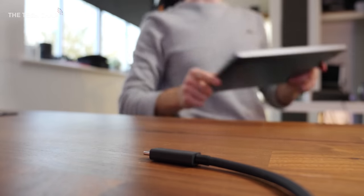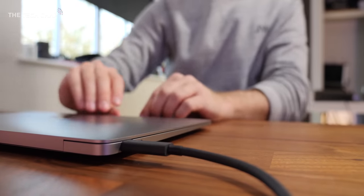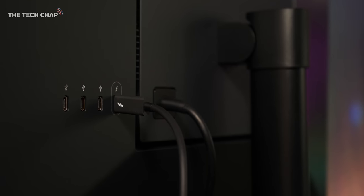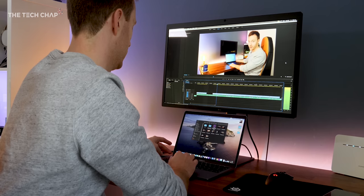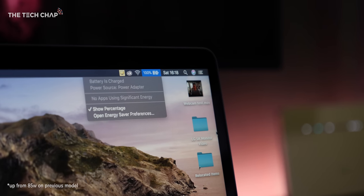I think it's great. All you need is one cable — one Thunderbolt 3 cable that comes bundled in the box. Plug in your MacBook Air, MacBook Pro, Dell XPS 15, whatever Thunderbolt 3 laptop or PC you have, then connect it to the Thunderbolt port on the back — the one with the ring around it — and you're done. This one cable takes care of video, sound, and gives you 94 watts of power, so it charges your laptop at the same time.